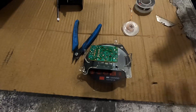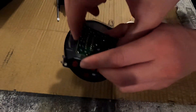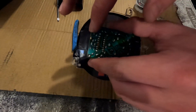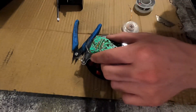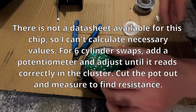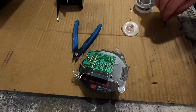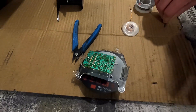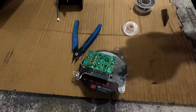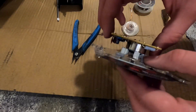Mod's completely done. If you have a Gen 4 or a 2AR, you're done. Now if you have a V6, you need to change this resistor here. Since this is an inline 4, I don't need to do that, but I'll give you the resistor values on screen. That's the only mod I needed to do. If you're buying wiring from someone and they tell you you need a signal converter, you don't. If you have the ability to wire in a signal converter, you have the ability to do this — it's just one resistor, it's that simple. And now our tach will work with a low voltage signal.